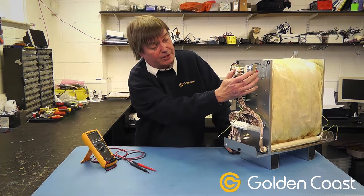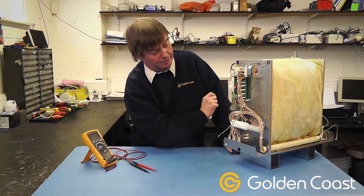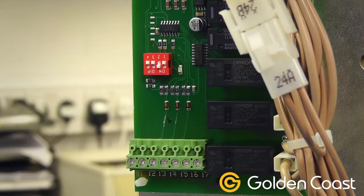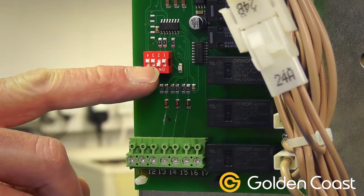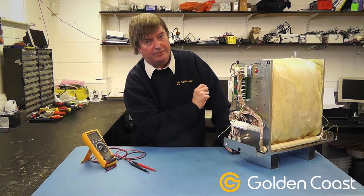The overheat stat as we say normally cuts out with calcium. The relays don't give many problems. And the little switches in the middle are for the cleaning cycle. This one is set with number 2 on, which is a standard way of setting them. And that gives us a clean every 4 hours.